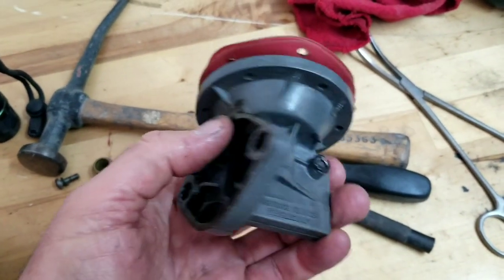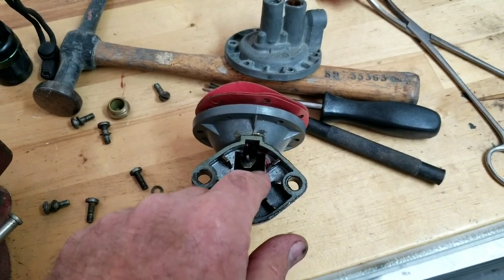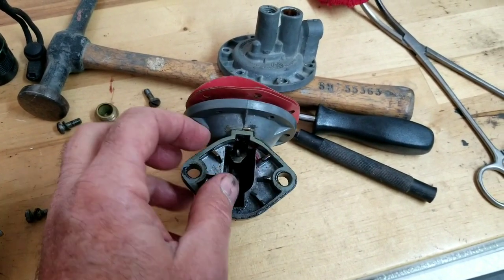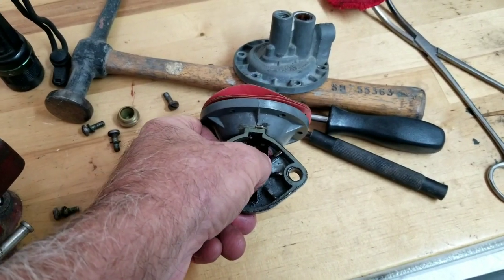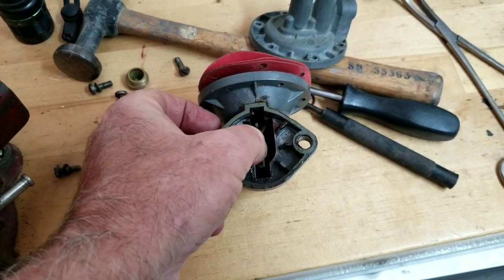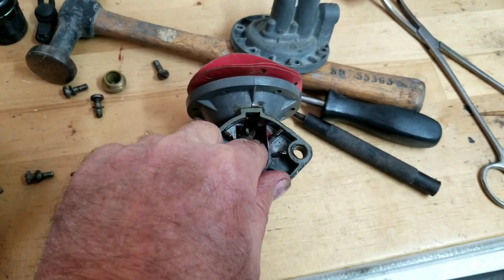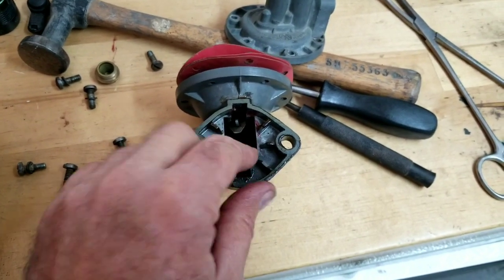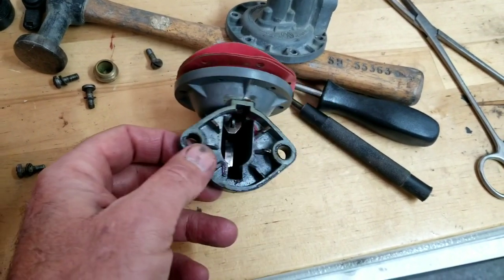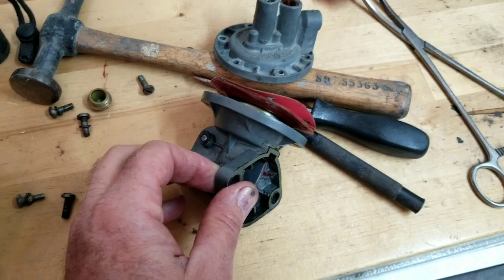That's how you actually assemble that fuel pump. If you can be fortunate enough not to take this lever off - if your lever is in good shape - you might not want to push that pin out when you go to take it apart. What I would do is try and pry up on here, push this down, maybe use a pair of needle nose vise grips to hold it in place all the way down, then twist and use a screwdriver to actually pull this lever off that shaft. If you take that pin out, you're in for a nightmare.